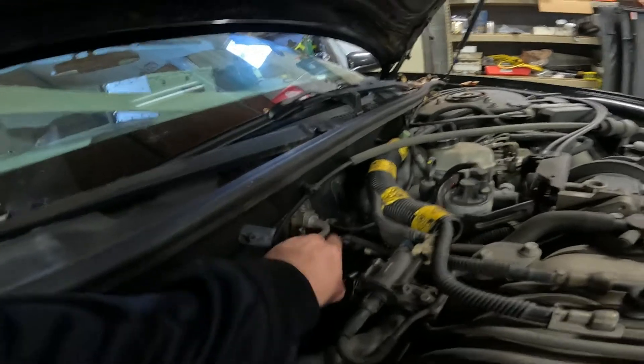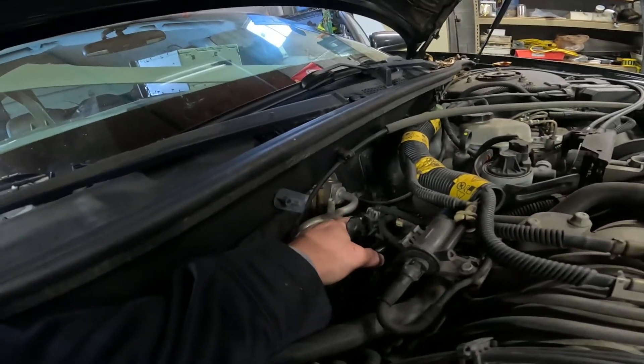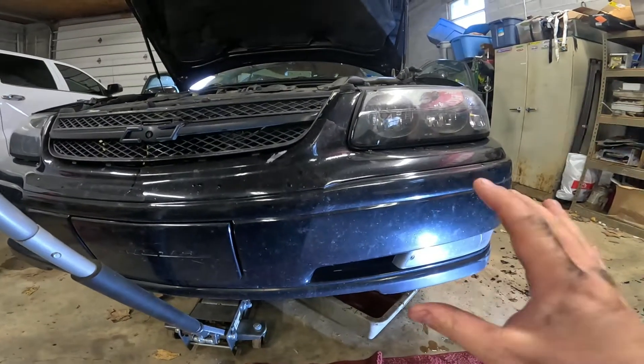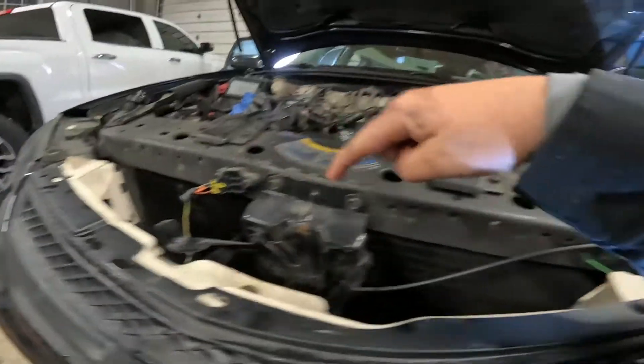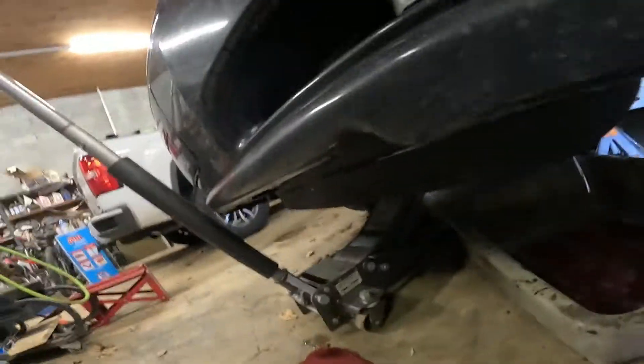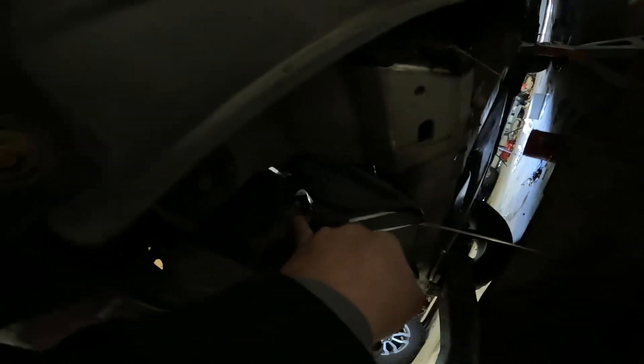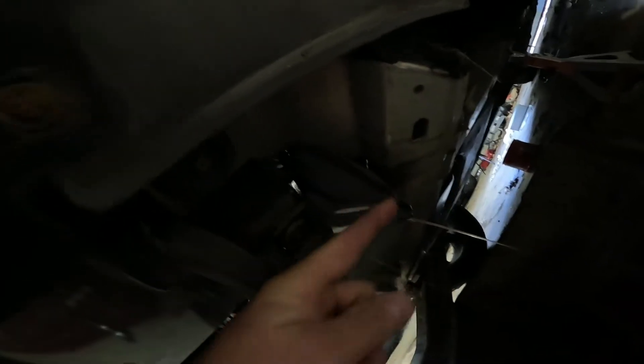Up here, you can see it comes out. It's not this connection right here — that's for your condenser evaporator for the AC. It's right down below it to the right — it's these two hoses right here. To drain the coolant on this '04 Impala, you've got your radiator right here. At the bottom of the radiator, you're going to pull back this piece of plastic. On the bottom corner facing that way, you're going to have a plastic drain plug and that's going to be a 19-millimeter. You use a socket and ratchet, you'll be able to thread it right out, pull it the rest of the way out, and it's going to drain right back here — right at the bottom corner of your radiator facing the back of the car.